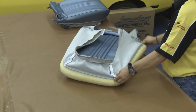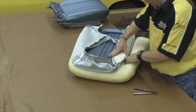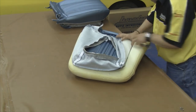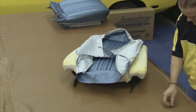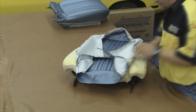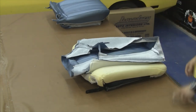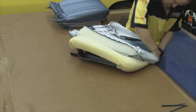Now that our bottom is complete, we can move on to our front seat top. Position the cover, turn it inside out, position it on the molded foam, and make sure it's symmetrical top to bottom and side to side. Our first step will be to take the listing pockets sewn into the seat cover, tuck them down through the molded foam and through the cotton, and attach the hog ring around the paper-coated listing wire — all the way down through the molded foam and attach it to the paper-coated listing wire attached to the top side of the burlap. Repeat the process on both sides and make sure the seat cover is installed symmetrically — this is a very important step before you wrap the edges of vinyl over the edges of your molded foam.